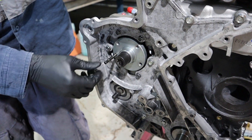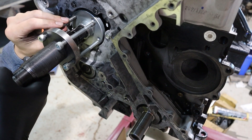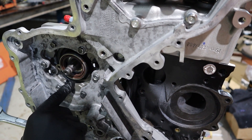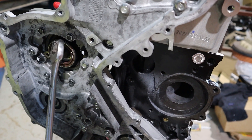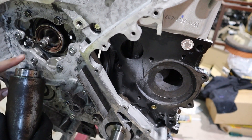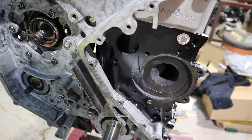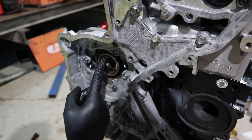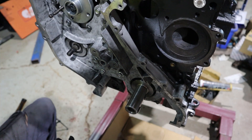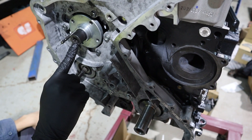Lock the fuel pump, then undo the T-70 and remove it. Install the fuel pump boss puller tool. If you need to replace the fuel pump seal, use a big spanner to get the old one out, then use the seal tool — paying attention to the orientation — and tap the new seal in with a copper hammer, making sure to grease the inside. Put grease on the fuel pump thread, install the fuel pump boss, reinstall the lock and pin, put a little silicone around the fuel pump nut, install the nut, and torque it to 90 newton metres.